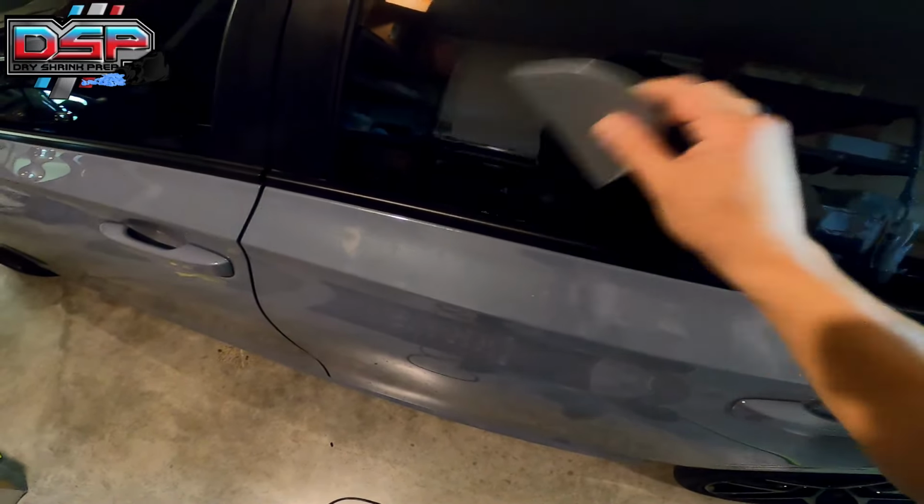And if you have a finger right here on the back doors, it's going to be in the back area. In the front doors, you're going to line it up right against the A or the B pillars, 1.5 inches from the bottom, and you're going to have overlay here. So you use your card to block any of the film that's laying up that's not on the glass. You block it from that heat, if you need a heat finger here, to protect that overlapping film so that it doesn't heat crease and shrink and mess up.